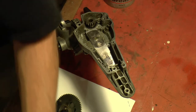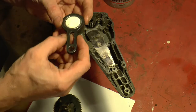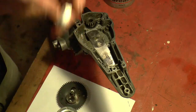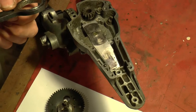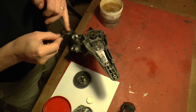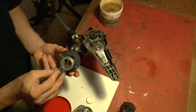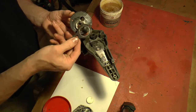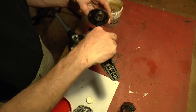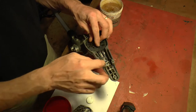The next part is one of these needle roller push rods. This is the push rod that converts the rotary motion into a pushing motion. I'm going to take that plug out and pack this bearing with a bit of grease. These don't seem to have a particular side - I think they can go any way up. That's going to go in there - it just needs to locate. There we go, that's on there.